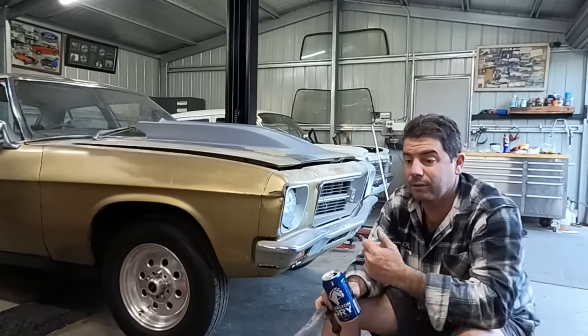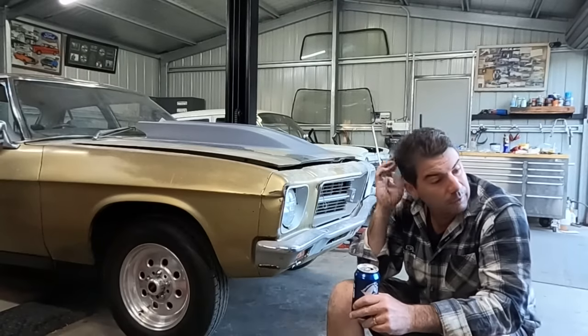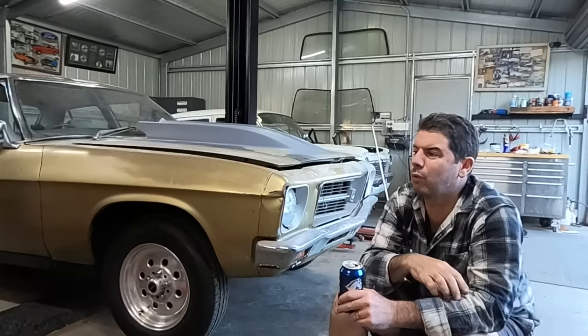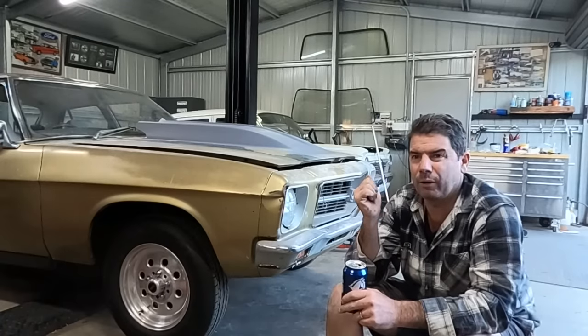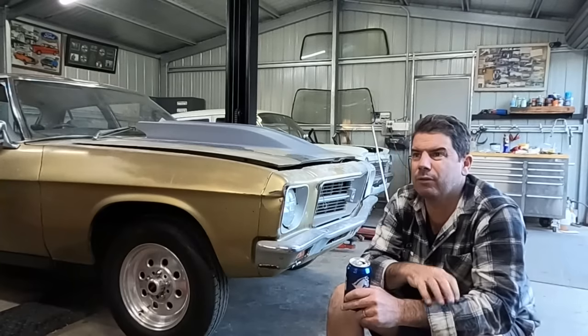So anyway, it's done and it's running. It drove not well, and I think I might have to pull the bowls off the carburetor. That has been sitting for a while, and modern fuel evaporates quickly and leaves behind a residue, and that's not idling great. One minute it idles, next minute it doesn't. So I might just clean out the idle circuit on it.